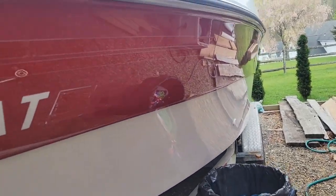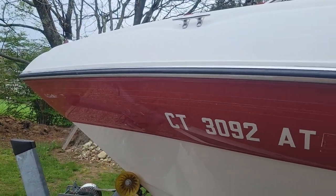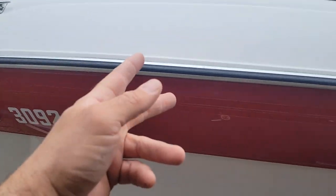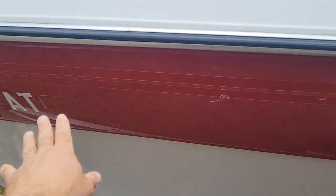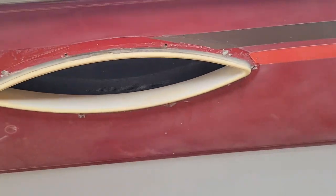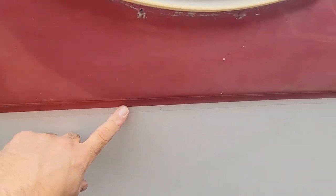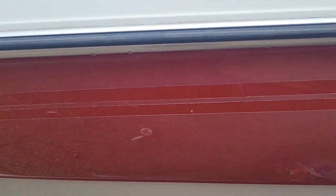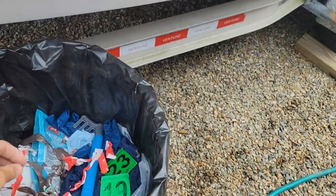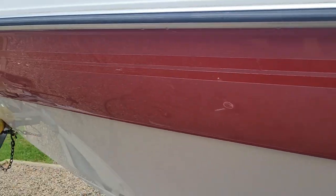I got smart and moved the generator a little further away. It's taken me about 10 minutes to get everything off over here — the two stripes, the red, the gray, the old stickers right there all came off. I did take a few minutes and pulled off the chrome trim here because you can see the sticker goes underneath, and if I'm going to pull these stickers I'm going to do it right. I'm going to leave this white one down here — it looks to be in good shape. The heat method with pulling it up little by little is definitely the way to go. I was getting off really long strips — it was almost like a challenge to see how long I could get. It came off great.